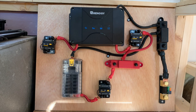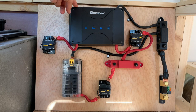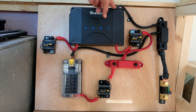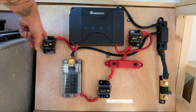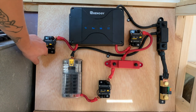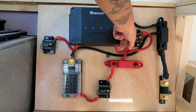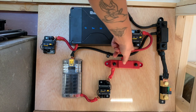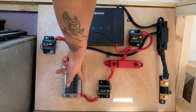So we'll start from the solar panel side. Our wires will be traveling right above here and get inserted right here at the positive, and then our negative will squeeze in here on the negative — this is the solar panel side. This is the common negative, and this is the alternator. I have four gauge wire running to an 80 amp circuit breaker, which is what was recommended in the instructions. From here, the wire goes to the alternator, and then the positive goes to the positive battery side. I have a 70 amp circuit breaker, also as recommended. All of that four gauge wire comes down to my positive bus bar, and then I have a 100 amp circuit breaker going to my fuse panel.